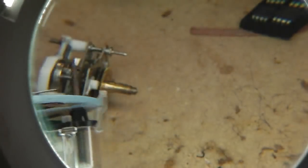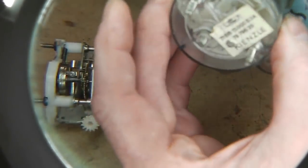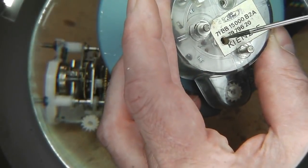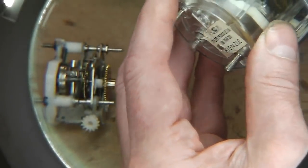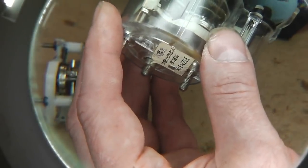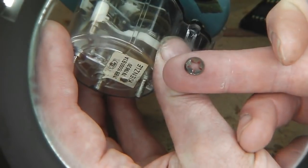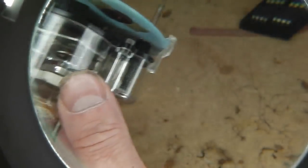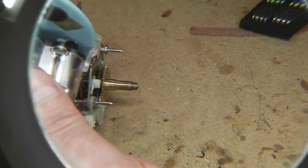But at least we've investigated the clock situation. It was quite easy to take apart. You just have to unscrew the seal, the factory seal. That sticker there reveals a little tiny screw, and that allows the mechanism to come out. There's a couple of little tiny spire nut washer things that we're always talking about, on the end of my finger there. You've got to hook them out, two of them, on the front plastic casing. This part is held in, and then the whole thing comes to pieces.